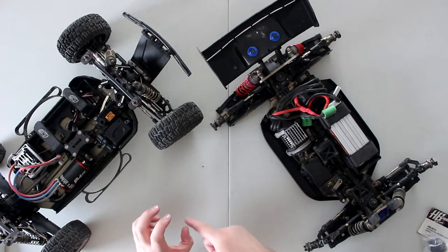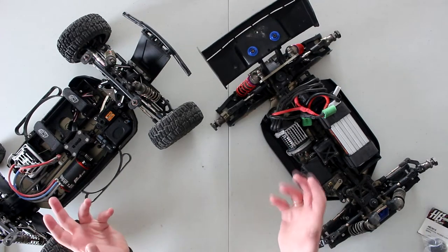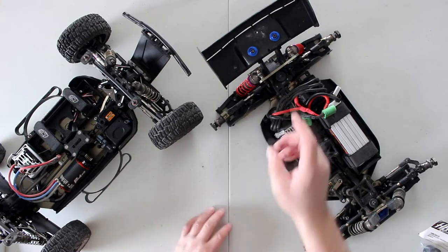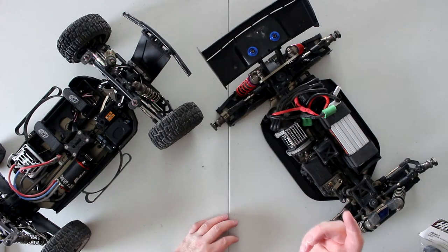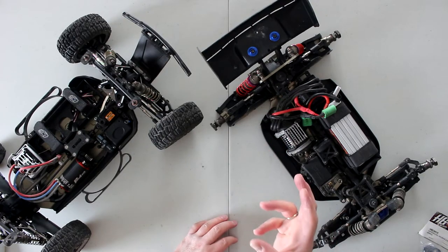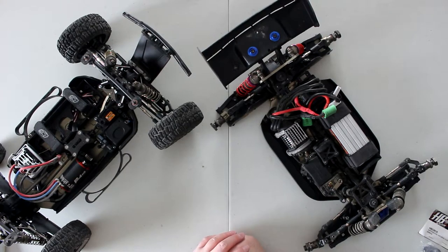The reason you don't want to fill that case with oil or grease is that with spinning parts the oil will expand and shoot out of every nook and cranny in the case, and it will basically coat your vehicle from A to Z. Then dirt and debris will stick to it — that's something you don't want.